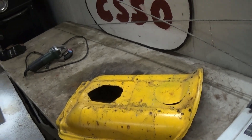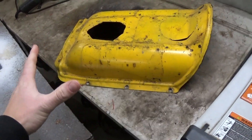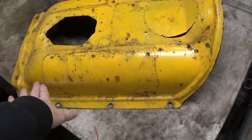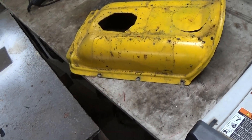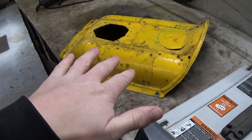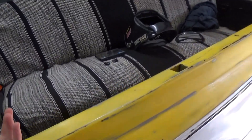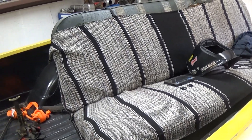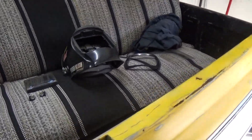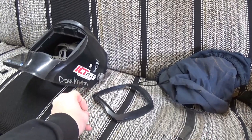This tunnel has been modified over the years and it's just an absolute mess. You can see where I patched up the original four-speed hole very poorly and left a huge gap, and then I cut a hole for a Turbo 400 floor shifter before switching to a column shifter. I'm cutting the entire top half of the tunnel off and welding a flat sheet of steel over it to lower the hump — there's no need for it to be so high with the Turbo 400. That will give so much more leg room. There's a guy in Missouri that reupholsters these seats at a pretty good price, using your seat back as a core, and I'm thinking about going that route.